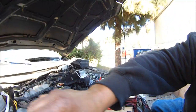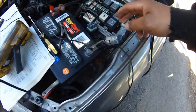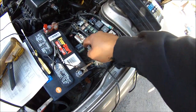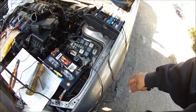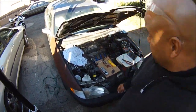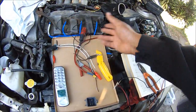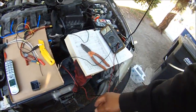A lot of relays will show you a small schematic of which side is the power side. There's an electromagnet inside between 85 and 86. Once you apply voltage, it causes a magnetic pull and pulls an arm to complete the circuit of 30 and 87. One more time: 85 and 86 — listen. That right there is how you test a relay. Relays work off 12 volts — they need 12-volt supply to close that little lever. That's how you test any relay with simple alligator clip wires.